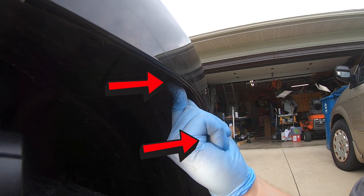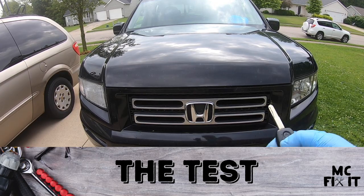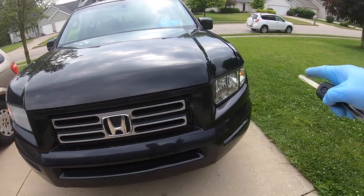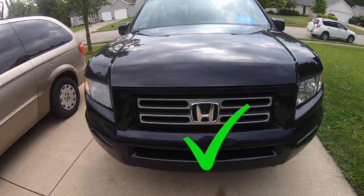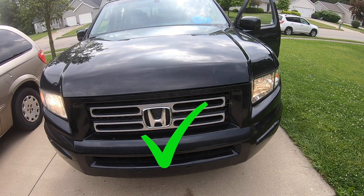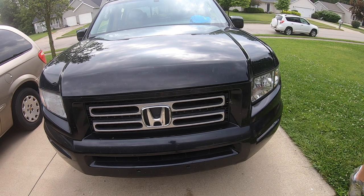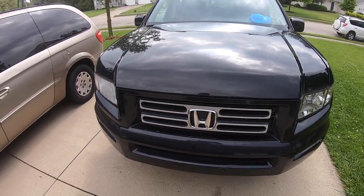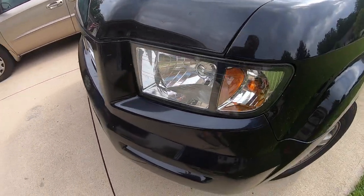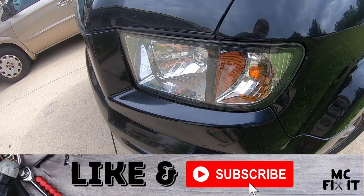Put the plastic back into place — the bumper's cracked here too, but it's an older vehicle, it does what it needs to do. Press it in and you are set. We'll go ahead and test the lights: with just the opener you can see both sides are working properly. Then we turn on the full lights — that's the daytime running, and that's the full lights. Then we test the driver side blinker, the passenger side blinker, and the caution lights — both at the same time. If this was helpful, please like and subscribe, comment if you haven't already, to help others find this video and figure out how to do this themselves instead of paying somebody else. Thanks so much for watching — hope you have a great day!